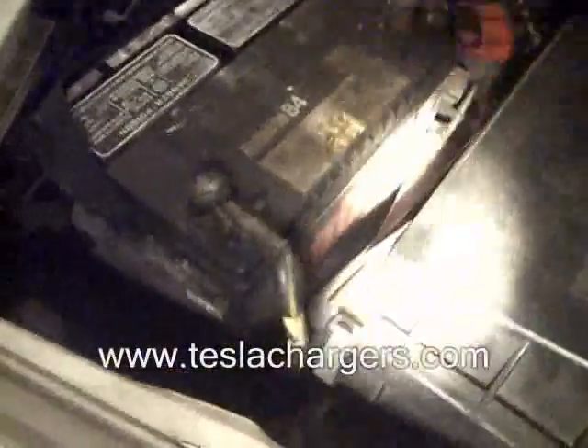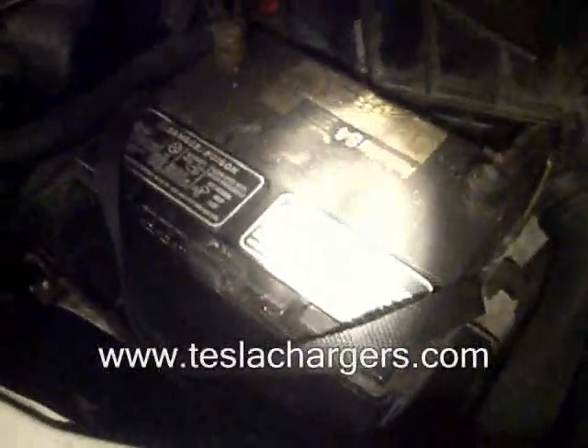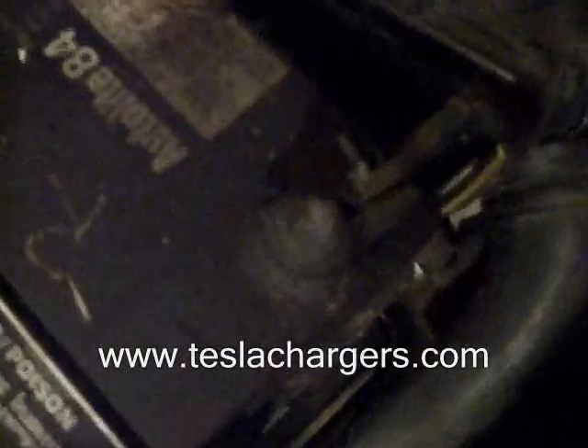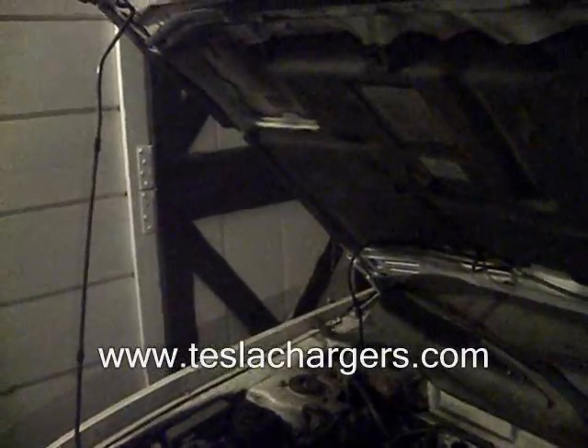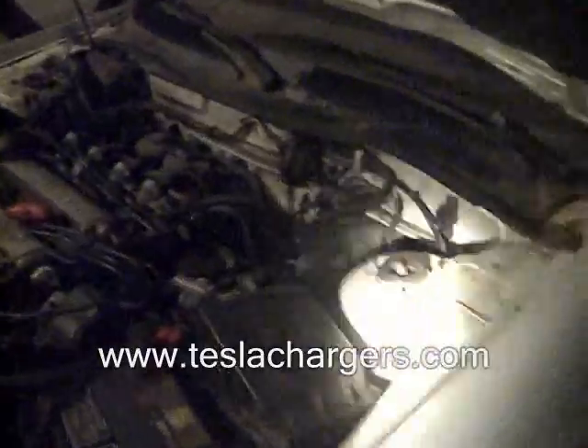Here's the battery that was at 0.75 volts — after charging with an Energenics R-Charge charger from teslachargers.com, it's resting at 13 volts. It needs to be cleaned off, but as soon as those terminals are connected I get some buzzing inside. We're going to tighten down those terminals and try to start the car — we're basically just moving it out of the way to get to the door. It's probably a mid-90s Nissan Sentra.